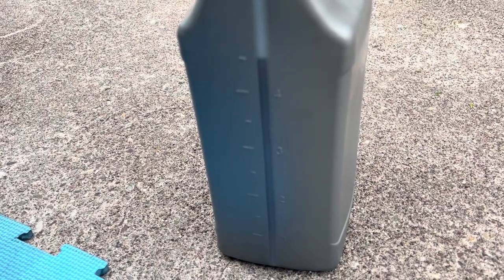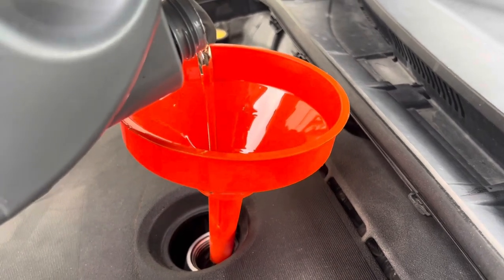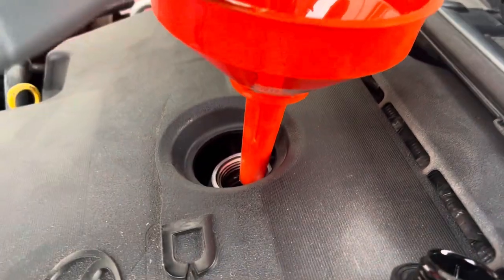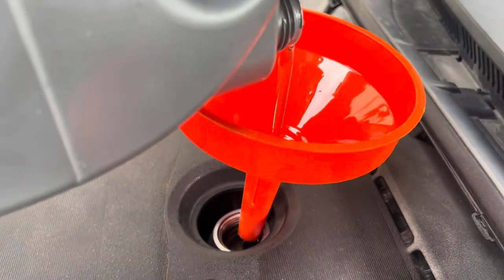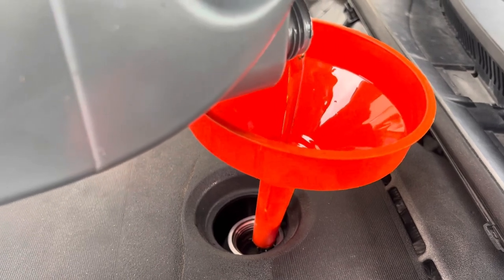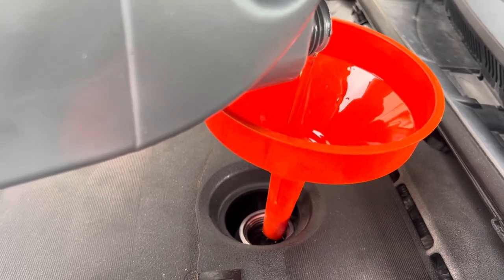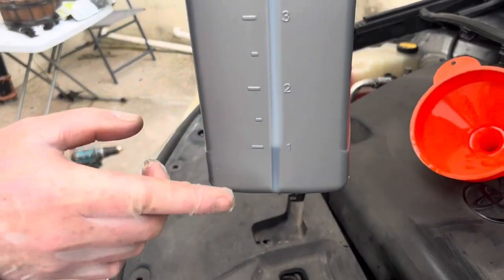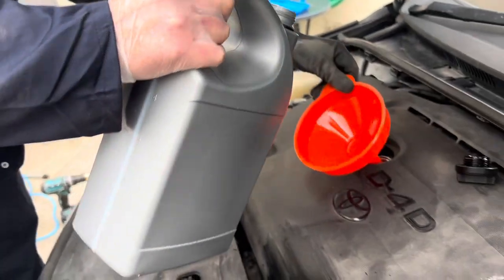As you can see, we have five litres of oil in that — we just lob that straight in, no messing about. I'm going to show this as I pour it in — I just take my time because it can easily overfill the top of the engine here. So I just want to get it in without spilling all over the place, because that's the last thing I want. If you're like me, just take your time. Get the five litres in and get ready with the rest. It's going in nicely — a nice oil transfusion for the car, and I can guarantee she'll love it. There's one more litre, makes it six. I did fill up the filter housing, so we'll throw this last bit in and it should be more or less it.